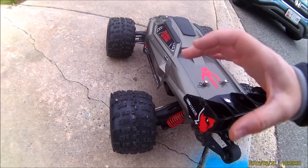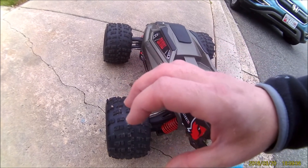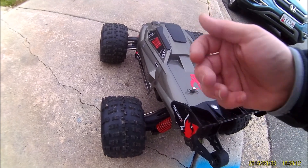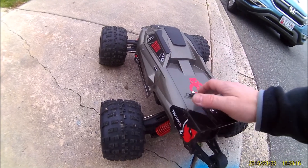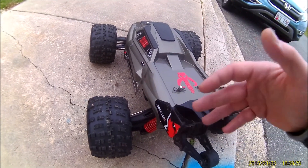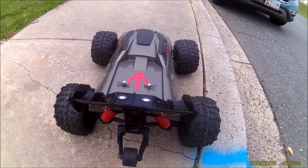I mean, meshing this thing - it's so tight. The 19 is basically reaching off the spur - the biggest you're going to be able to put on this with that 4S cover, because I can't back it off any more than it is. I back it off and mesh it, but if I push it forward anywhere other than all the way backed off to where the screw hole is, it's kind of tight. I could tell it wasn't right, so I didn't want to kill this spur and pinion.